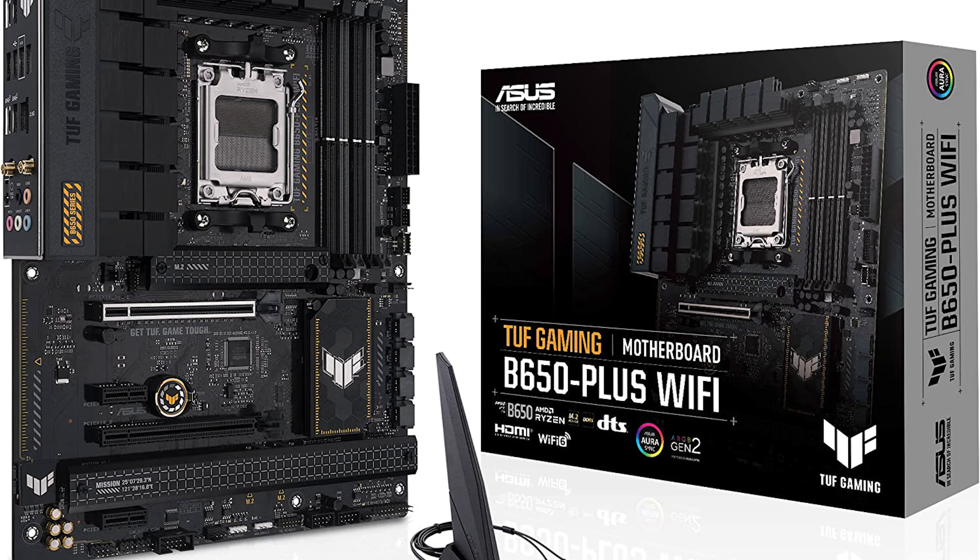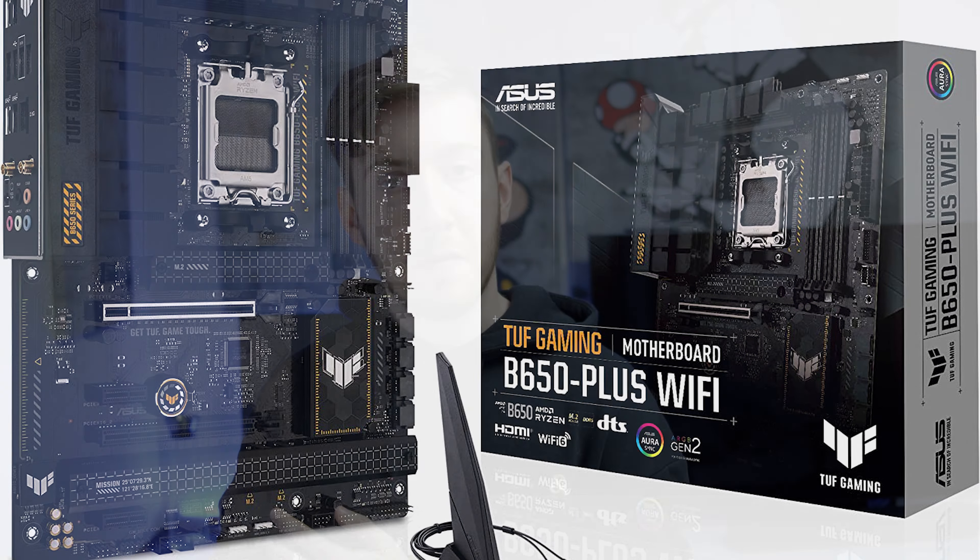There's an HDMI and DisplayPort as well, which is really nice for server applications or office work — you won't even need an external graphics card and can just use the integrated GPU from AMD. There's also Wi-Fi 6 support for really fast Wi-Fi — not the fastest since there's Wi-Fi 6E, but it's fast enough. And if you want something even faster, you have a LAN port with up to 2.5 gigabits. All in all, it's a really nice mainboard, especially if you don't want to pay a fortune but still want nice features.